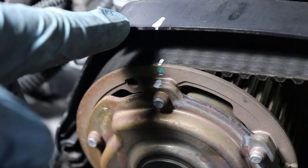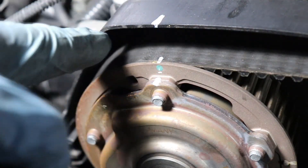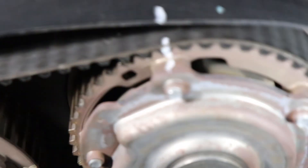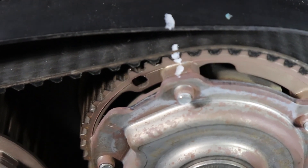Your mark should look like this: a white mark on the sprocket and then a white mark on the plastic timing cover, and the same for this one — just to give you an extra hand to line it up perfectly.